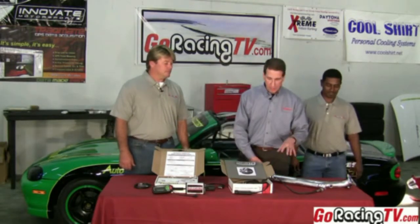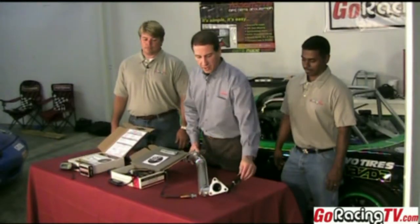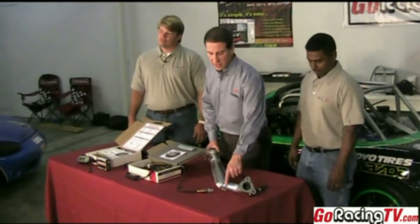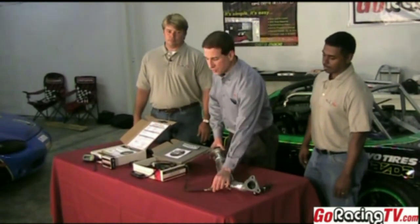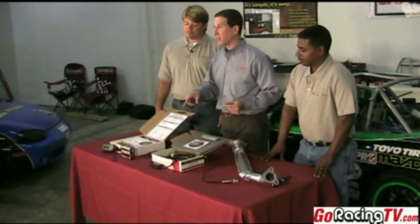What we're going to do today is hook up this air-fuel mixture reading onto the TrackMate. This is a downpipe off the car — this is the stock O2 sensor here. We've welded an additional bung in so we can put in this additional O2 sensor. That goes to the Innovate Motorsports LC1 Lambda sensor, as they call it. It puts out an electronic signal that we can read with the TrackMate, and that will tell us the air-fuel mixture. Now, why that's important is because you might change something on your car — maybe you put in a different air intake and it changes the air-fuel mixture. You're getting more air in, so it's going to change the mix. To get the most power, you have to have the optimal air-fuel mixture.